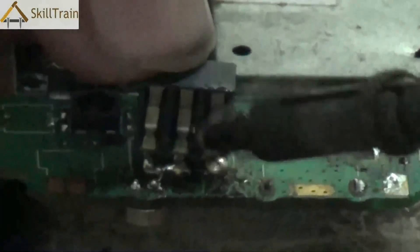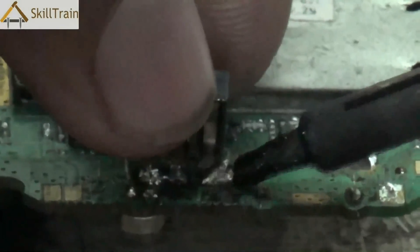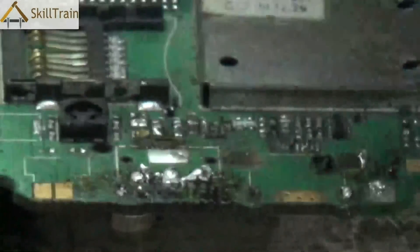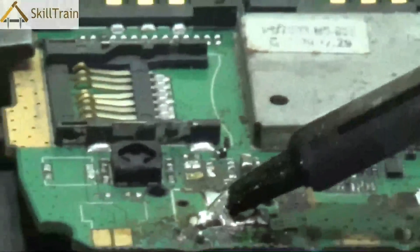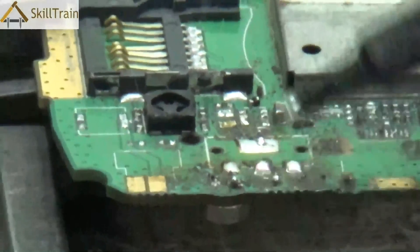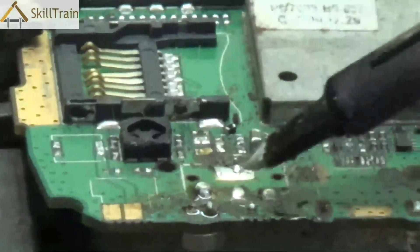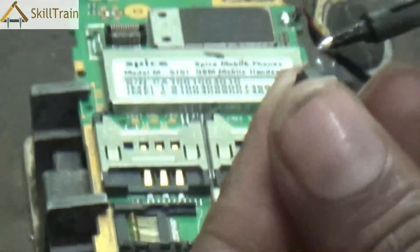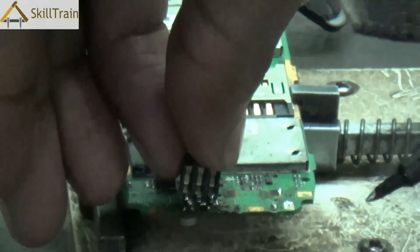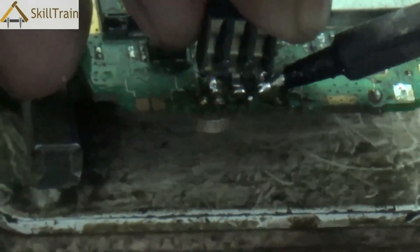Because the points are too close, they may sometimes overlap. If it overlaps, use the soldering iron to remove the connector again from its position — or use the hot air gun to take it out. Clean up those three points so that all the extra soldering is removed, giving you a clear view of the three different tips where the battery connector needs to be soldered. Take a little bit of melted soldering lead and put it on the three connecting tips at the battery connector, then solder them back in their original positions.